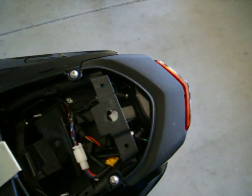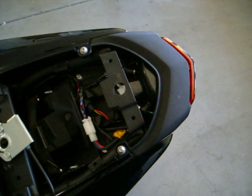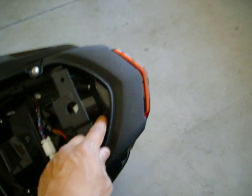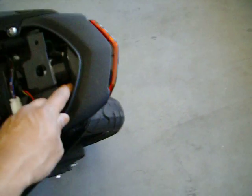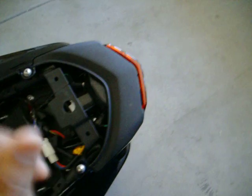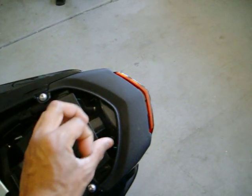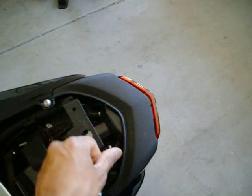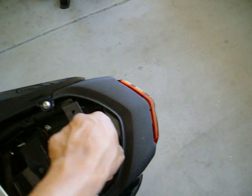which, for me, is a lot of hassle, having to clean the plastic again so you can put any kind of sealing that he's gonna use in order to keep it in place. Now what I did, I just drilled a hole on the tail light with the 1/2 inch drill bit, if you have one. That's pretty much the size you're gonna need for the bulb to squeeze in. I mean, the light bulb's gonna hold in, because the hole is a little bit smaller than the light bulb, but since it's plastic, you can pretty much just press it in there and it's gonna hold, which is what I did. And the light bulb doesn't move at all.